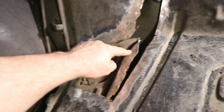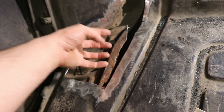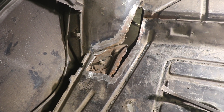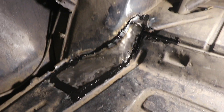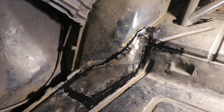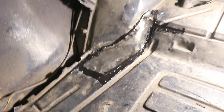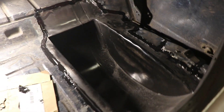I got most of the bad stuff cut out. I decided to go back far enough to get a good solid chunk, and then I'll take some cardboard, mock up a sheet that I can fold and hammer to the right size, then cut it out of sheet metal. I cleaned up along here and I'm going to drill a few holes so I can spot weld it along here to tie it all back in. Got the plate in there - by the time I got it beat up enough to take shape, it looks beat up, but it's in there. I replaced most of the bad stuff, put seam sealer on to get everything sealed up, and once it sets and dries I'll shoot some paint on it.